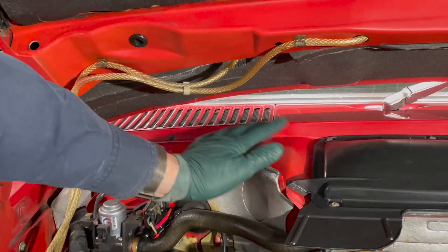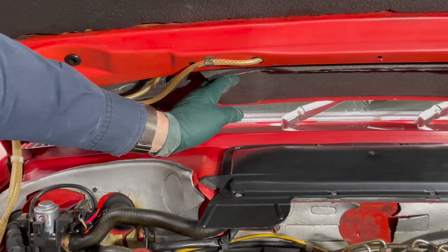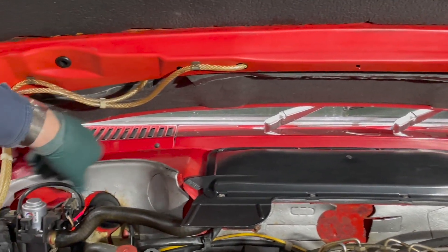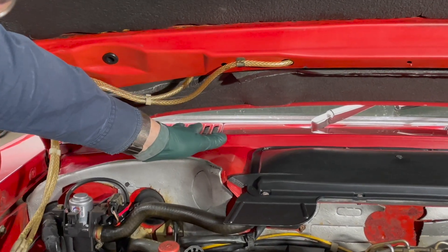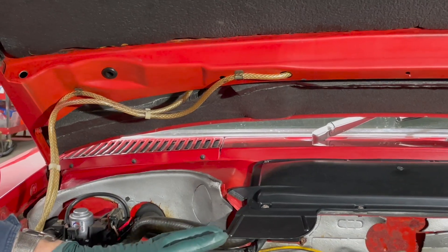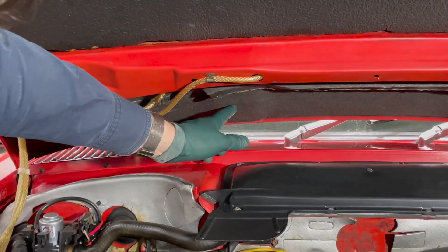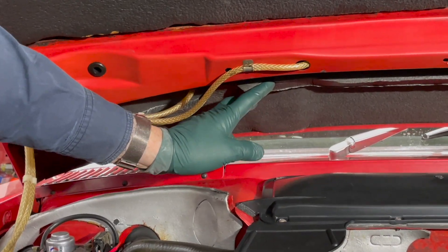While you're underneath here doing all this, I highly recommend that you replace the hood seal — not a hood pad, a hood seal. It's a very critical seal that seals this edge from engine fumes leaving the engine compartment and leaking into the cabin. If you're driving your SL and smelling engine smells, it's very likely that this seal has deteriorated. We sell these seals on my website with the correct glue to install them without pain and suffering.